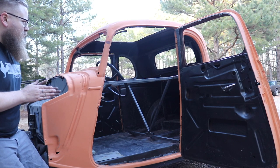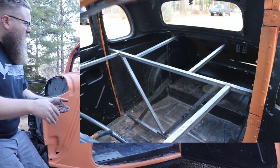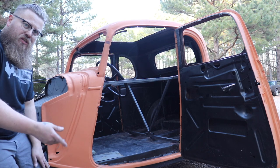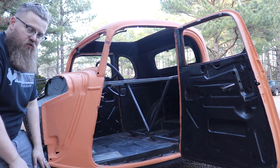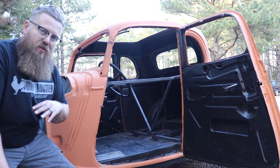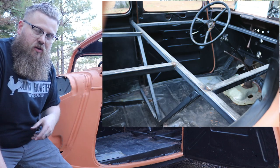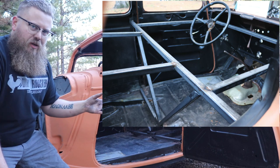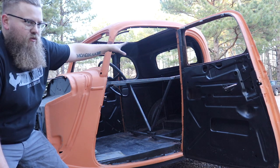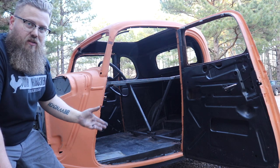On this body style, I have those center pieces in the back close enough together so I can cut the roof a certain way and pull it down. I'm going to have the roof sitting inside the cab before I make my second cut so I can scribe where the roof is sitting on the back side of the cab — that'll make more sense in my next video. The main idea is your braces need to be set up so the body can't go in any direction once the top is off. I didn't structure the pillars, I structured the cab — the pillars are going to get moved and angled. I'm also going to be pie cutting the top and moving the pillars forward and back to get my angles right, so I'm not worried about structuring the roof. That's not for every car — some cars you do need to structure the roof depending on how you're going to chop it.